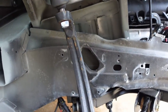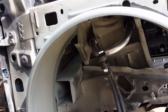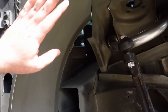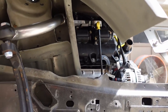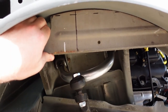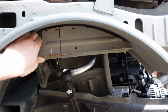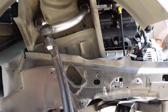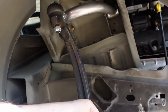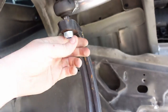But after that, ran into issues with the upper control arm. But as you can see, I now have big old fender tubs. Went ahead, tubbed into the firewall a little bit and clearanced up overhead. So the original frame sat about here, and you could see upper control arm at full droop was pretty much making contact already. No good. I had no suspension movement at all. So with that out, I'm able to get a decent amount of movement out of it. Haven't actually tightened it, you know, just mocking it up, I guess.